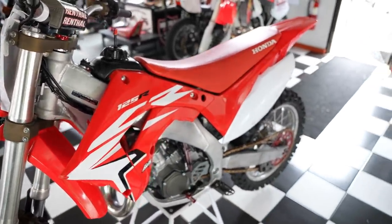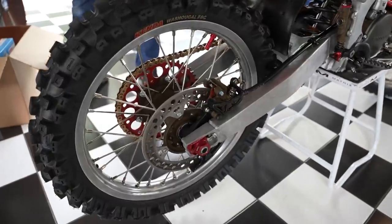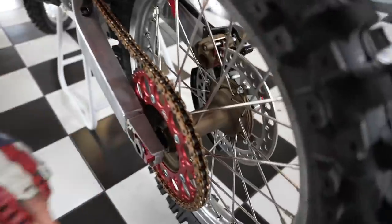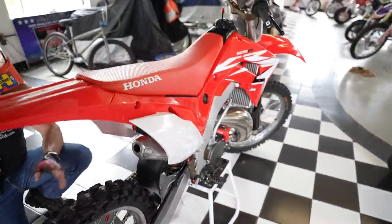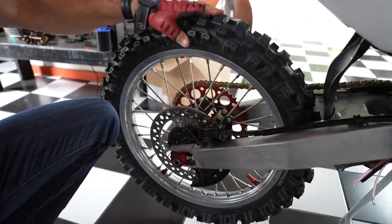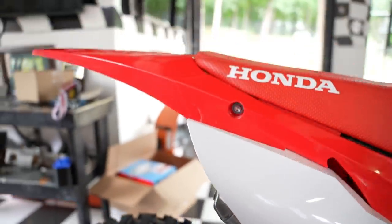The rear wheel had the same treatment as the front — completely dismantled. The hub was Cerakoted, new bearings, brand new Renthal top-of-the-line red sprocket with a gold chain, brand new Renthal. The wheel was completely dismantled, polished and vapor blasted, with brand new spokes. All new hardware holding on the new brake rotor. New Hammerhead axle adjusters anodized red, new axle adjuster nuts. All hardware on the bike is either mint original or brand new. The swing arm was vapor blasted. The rear master cylinder was rebuilt and Cerakoted. New rear rotor — the rear brake system is completely rebuilt. Brand new Kenda Washougal rear tire, still has the hairy nubs on it, brand new tube. The PolySport shock protector and restyle kit are brand new, graphics are brand new.